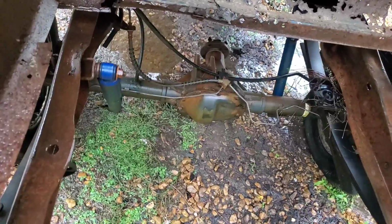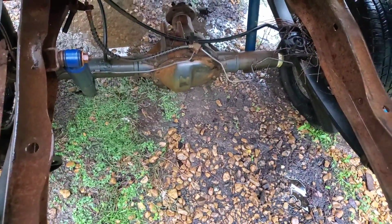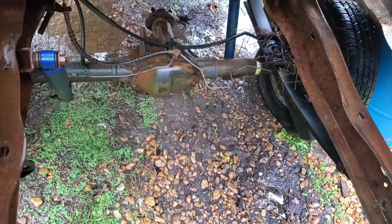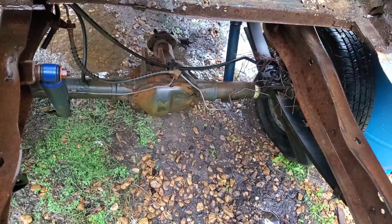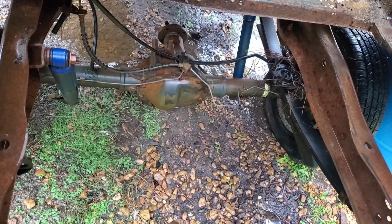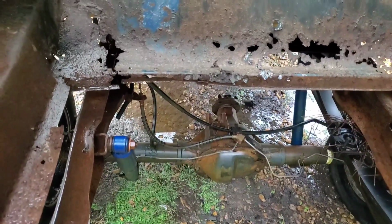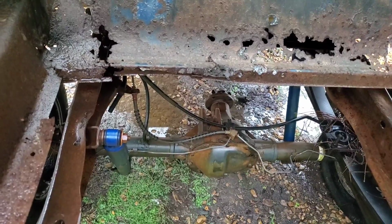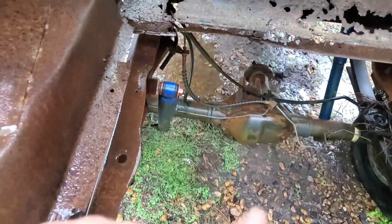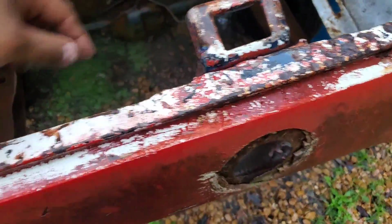Now, of course, this car is not going to have a rear trunk floor gas tank anymore. That's obviously a given if you know the design of a vintage Mustang. So depending on how the body is placed on the frame, I might go with the fuel tank that came with the Ranger and just figure out some type of filler tube setup, even if it doesn't involve using that port anymore. Or I'll just install an aftermarket fuel cell in here with the tube coming up to the port right here.